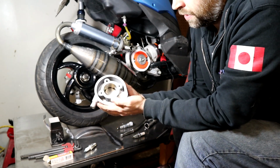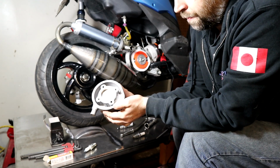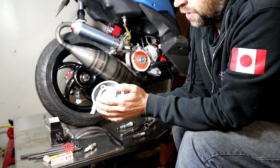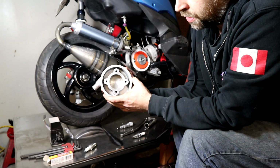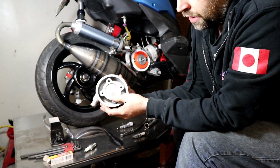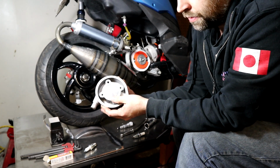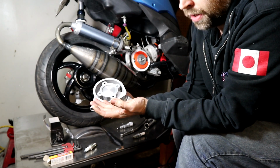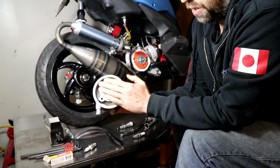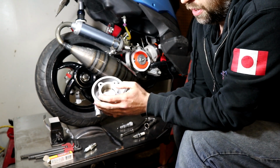So as the piston is coming up the bore, the spark event will happen. And depending on piston speed, so RPM, the amount of squish, so once the ports close over and it starts compressing the fuel mixture, it has it so that the spark event happens before peak cylinder pressure, so that as the flame front propagates, it allows the piston to come back down.